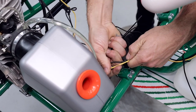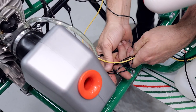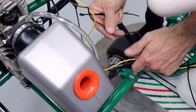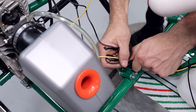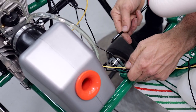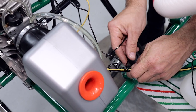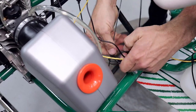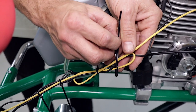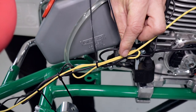If you have any excess cable, you can double it back on itself down here underneath the seat. We don't have a seat in this go-kart just yet, but if you did you could drill a couple of little holes and with the wires doubled back on themselves, put a zip tie through. Then zip tie the rest of the cables along the side of the seat by drilling a few little holes for those cable ties to fit through.